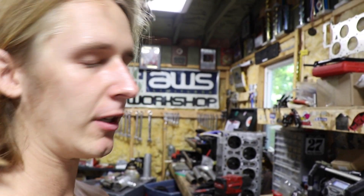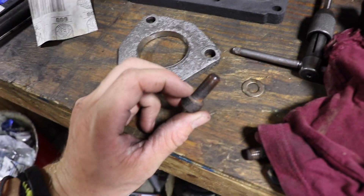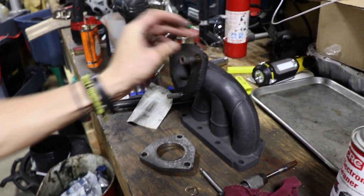I'm definitely going to use anti-seize — either copper or the gray aluminum style. The gray stuff is great because it leaves a film on your bolt and doesn't burn off even in a header environment. It's essentially aluminum or copper shavings on your thread that allow it to come back off. I also recommend brass nuts with a high quality 12.9 grade bolt — that's the strongest grade you can buy and it holds up the longest.